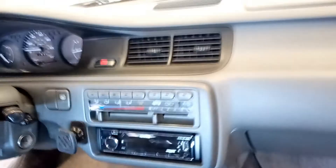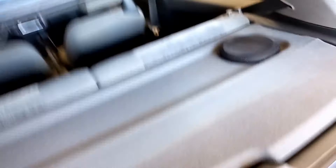So that's it, guys — basic install. Four speakers, subwoofer, amplifier. Stereo was already installed, but we went ahead and rewired it because I didn't like the cleanliness of the connections. Bass knob right there by the seat. Amplifier under the passenger seat — you can't see it there, but trust me, it's under there. The sound processor, or epicenter, is under the driver's side. We've got a 12-inch Kicker L7, and Kicker 6.5s in the back dash. The back dash is removable, so we put a quick-connect plug so you can remove them and unplug it.